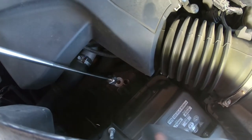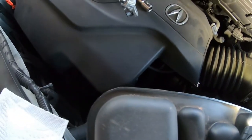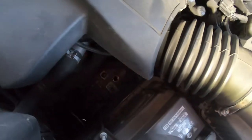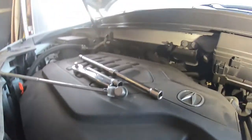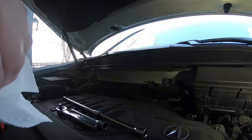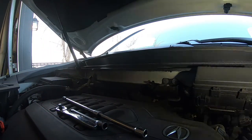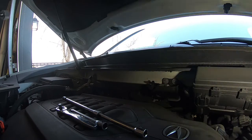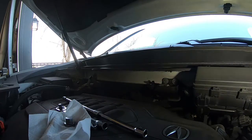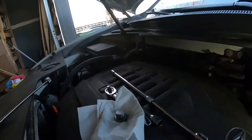Just bring it up gently. There is a little aluminum washer that's not magnetic — it's not attached, but it sits in there. Looks like it stayed in place down there, so I'll have to adjust it later, or just make sure you don't leave it. Since that's not really like a true sealing surface, it's more like a seal, but it doesn't have a constant volume of liquid behind it the way the drain plug would. I personally would not worry about replacing that particular crush washer — there are other crush washers that are much more important to replace.